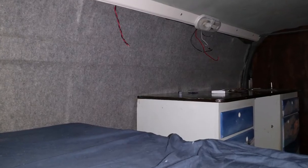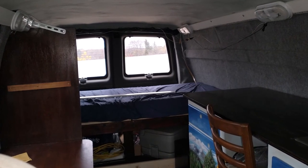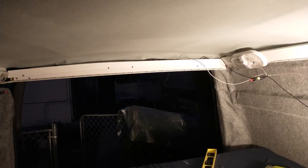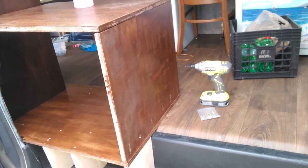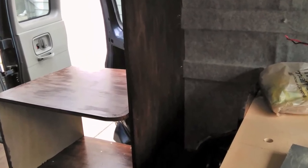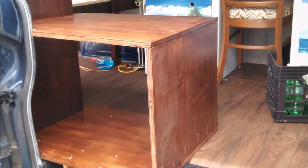The seat stays with a bunch of cord that attaches from side to side. I had to put trim on top — these are baseboards — but at the back I had nowhere to attach it, so I cut pieces of wood, bolted them to the frame, and then attached the trim to those. This leaves space to hang the curtain underneath. The kitchen area goes between the passenger seat and the wall, bolted to the floor, ceiling, and other pieces. The stove goes on the front side and the electric panel on the other side.